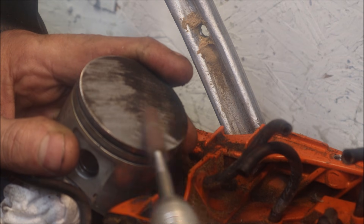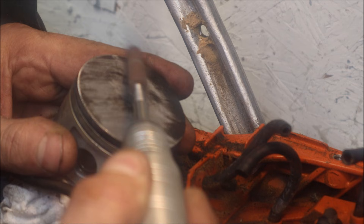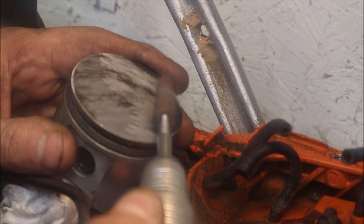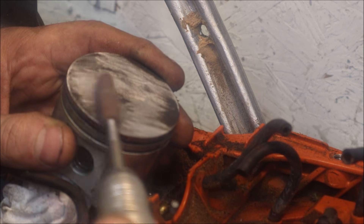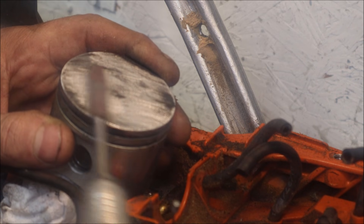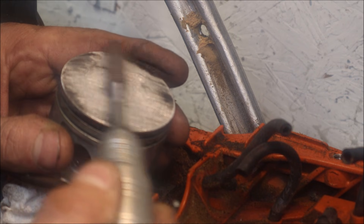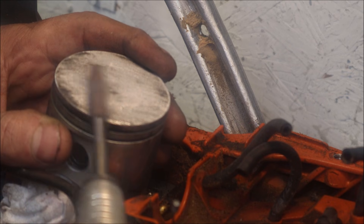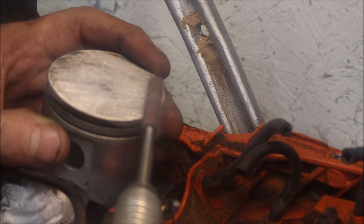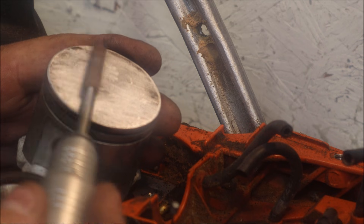Hello everyone. What are we doing? We're cleaning the carbon off the top of a 390 XP piston. We do work up here to kind of a mild polish, but this video I just wanted to try something different. Right now I've got not really what you'd call a coarse cartridge roll, but maybe like a worn-out coarse cartridge roll, and we are getting all the carbon off the top of the piston. I personally will not check any kind of timing number or squish unless all the carbon has been removed from the squish band and the crown of the piston.